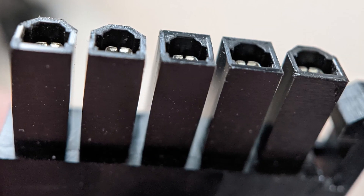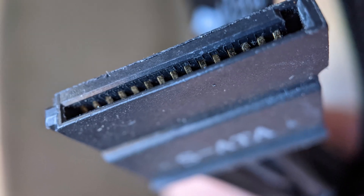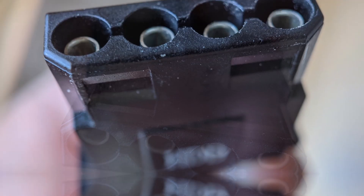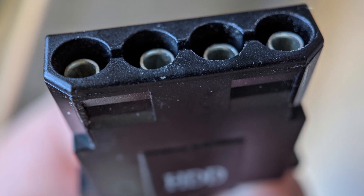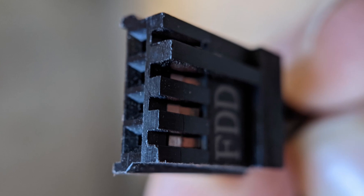This is called a drive cable. It will connect from the power supply to power the hard drive, CD players, or other accessory hardware components. This cable has a few SATA connectors that will plug into my hard drives. SATA is the newer style connector for accessories — it stands for Serial AT Attachment, AT being an old computer company. If you are replacing an old power supply, you might need to use some of the old style Molex connectors for your drives, or even the old floppy disk connector.